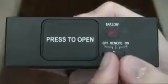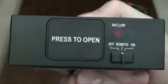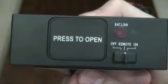To change the privacy code, remove the batteries or unplug the receiver and remove the batteries from the handheld. Change the position of the DIP switches in the handheld, then restore power and replace the batteries to both devices. Ensuring that the receiver is in the remote position, stand within five feet of the receiver and press the on-off button on the handheld. The receiver will beep to acknowledge the programming is complete.